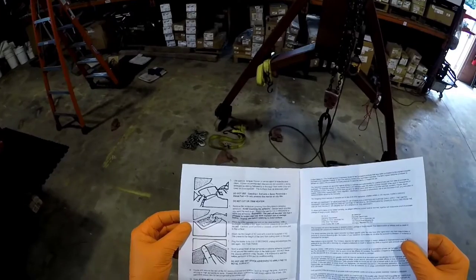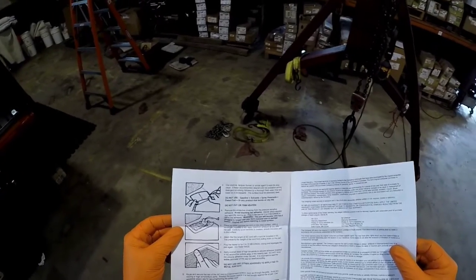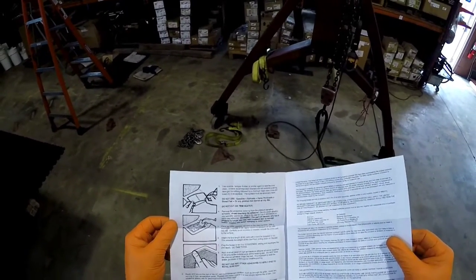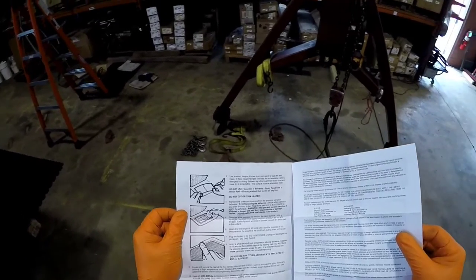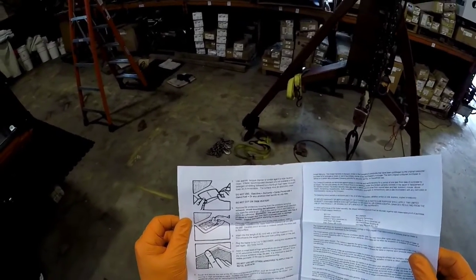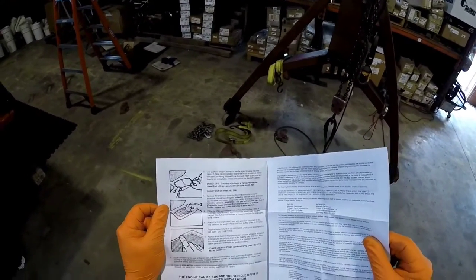Route the rest of the AC cord to a convenient location such as through the grill, avoiding any moving or high temperature parts. Position the power cord so it is held snugly against the oil pan. Use additional plastic ties for securing and routing the power cord. Keep all non-metal surfaces such as plastic, oil pan covers, noise suppressors, rock guards, and fiberglass shrouds away from the heater to avoid melting, warping, or fire hazard.